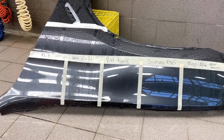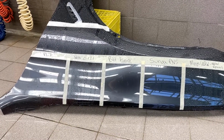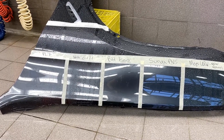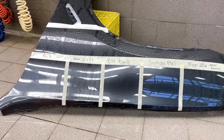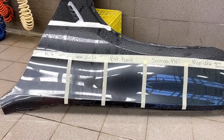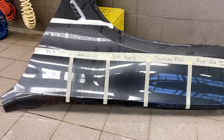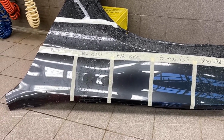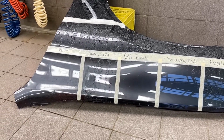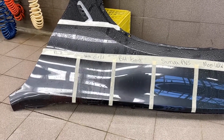Now, you don't have to panel wipe after using CMX, and it does have some abrasives, so for the products it does work for, it's a time saver. But in this instance, if you were to use it for something like Contact 121, you would then have to go around panel wiping that thing, and I don't even know if panel wiping really would take off everything that it's leaving behind in one go. So now you're looking at potentially multiple hits, or, Coles notes, use a different polish.